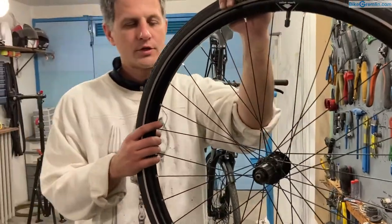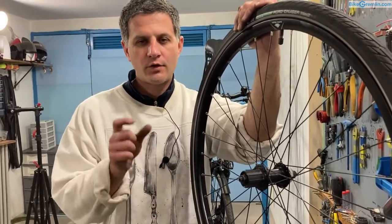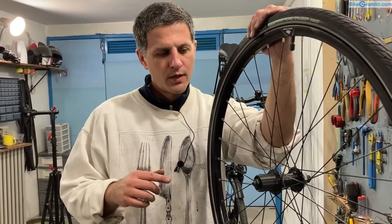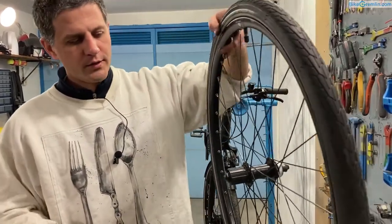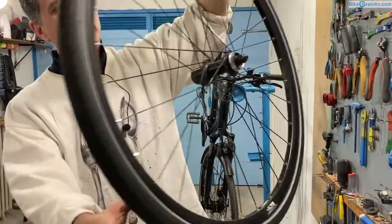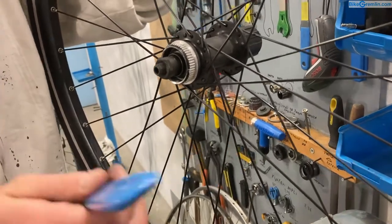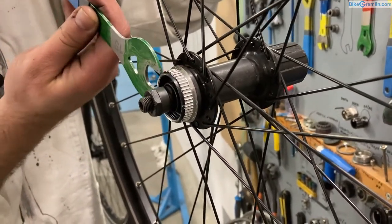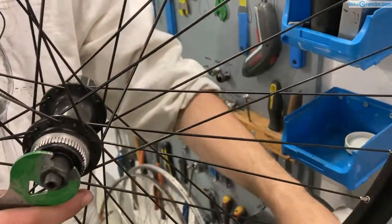For rear hubs I usually start on the left hand side. For front hubs with disc brakes I start on the right hand side because the left side is often occupied by the disc mounting area, so you cannot always access the cone to keep it in place while unscrewing the lock nut. Here we're going to the left side because on the right there's only the lock nut protruding and I cannot access the cone. I will put a 15 millimeter cone wrench here — a normal wrench that is wider would not fit — and I'm using a 17 millimeter wrench to unscrew the lock nut.